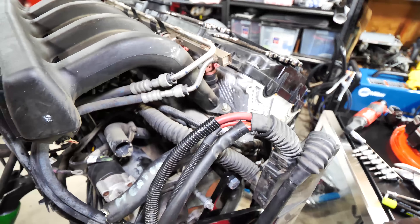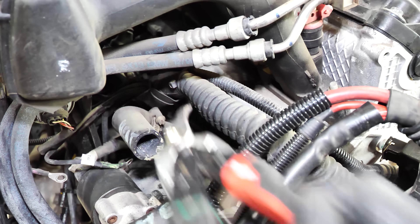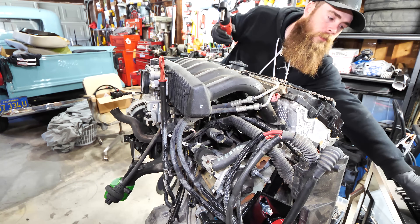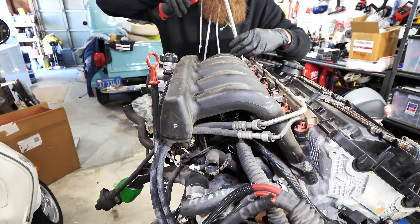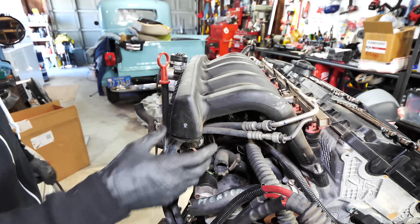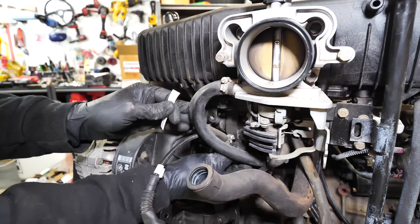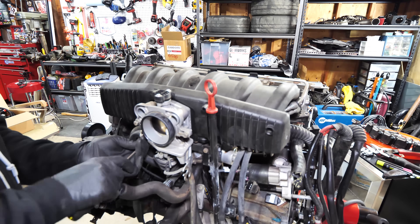Down in here there are a few areas with zip ties — trying to cut those without snipping any wires. There's a nice little metal channel right here that the harness sits in. I'm thinking it's going to be easier to just take the intake manifold off. I can see a couple of extra wires down there and it's not going to be fun to leave it on. Looks like it's 11 millimeter for the intake manifold nuts. There's another connector below the throttle body that I'll label 'below throttle body.'